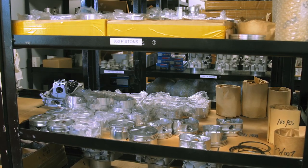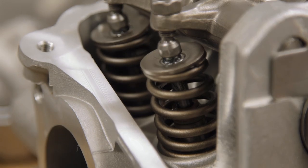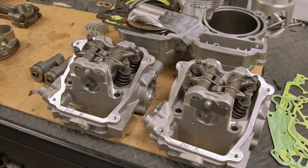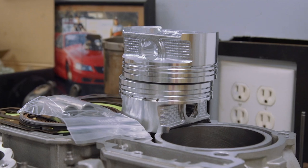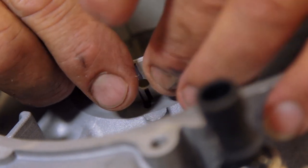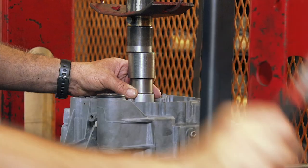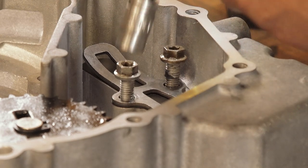This is an 800 Can-Am Outlander - it fits all Renegades too. We have a few kits for the 800: the stock 800 rebuild kit, the 860 which is a 94-millimeter version using the stock piston style, and then the 975. We've had the 975 for a long time - it works good with forged pistons, good for spray or full race versions, maybe turbo or something like that.